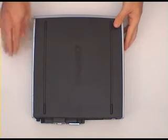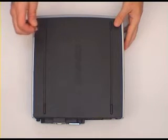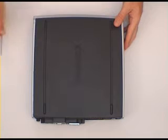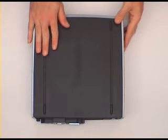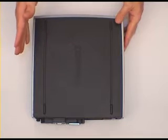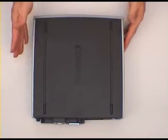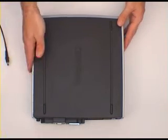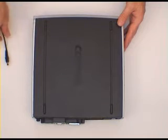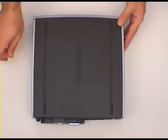Like usual you'll need a flat surface to work on. You may need a screwdriver depending on what sort of case you've got — this one we won't need a screwdriver today. Make sure the machine is shut down, not just hibernated. Also make sure you've discharged any static electricity from your body. Usually the easiest way to do that is to plug the machine into the mains, touch the metal case, and that will discharge any static from your body. You can also touch a metal doorknob or something connected to the ground. Make sure any power is disconnected.